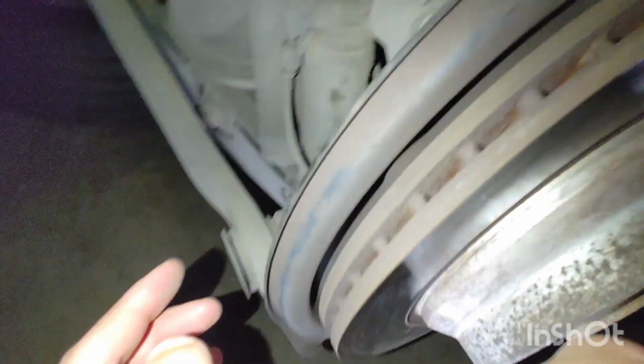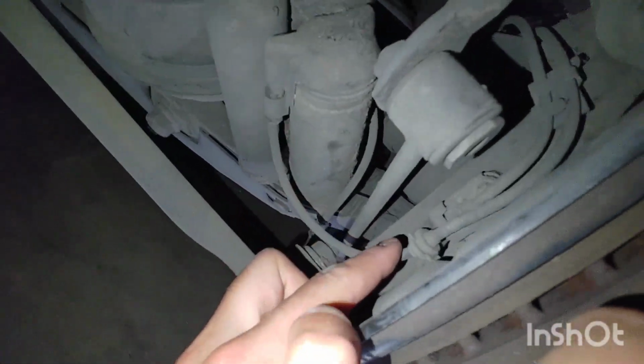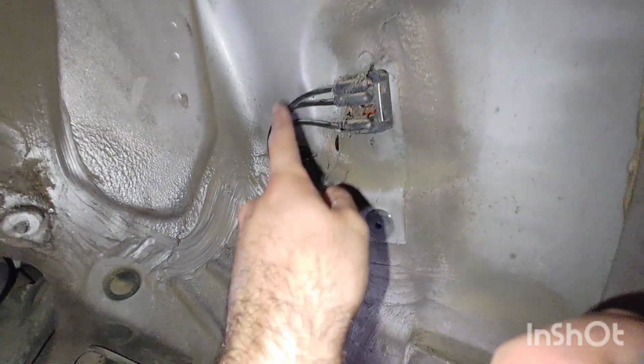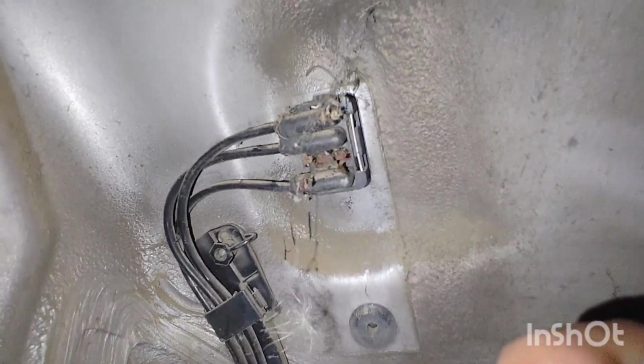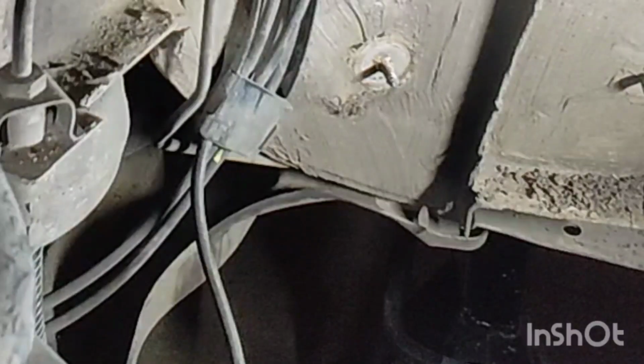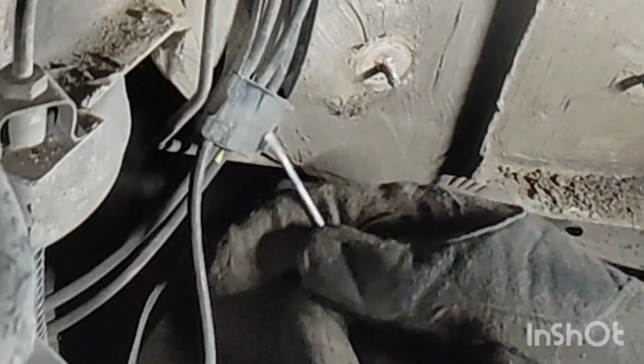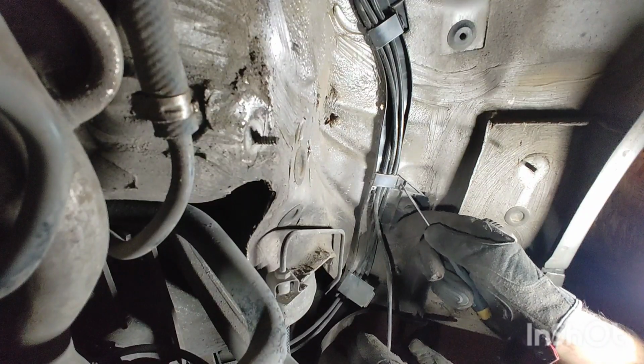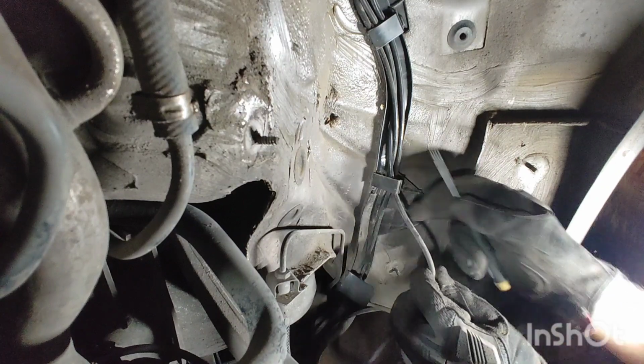Next, we have to disconnect the electrical connector for the air strut, so we have to follow this line right through here, down through there, up through that way, down through this way, and up to here. Make sure to clean off all this dust, debris, spider webs before you unplug the connector to avoid contamination. And for these connectors, this little cover, just slide that tab over and up. This little latch, slide it over to the right and up.